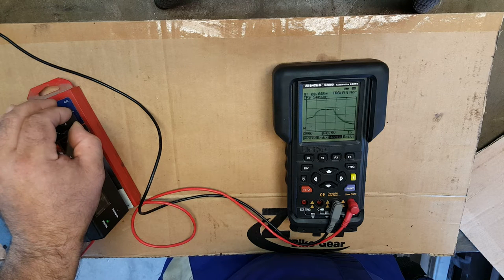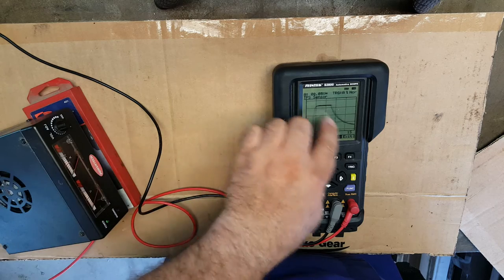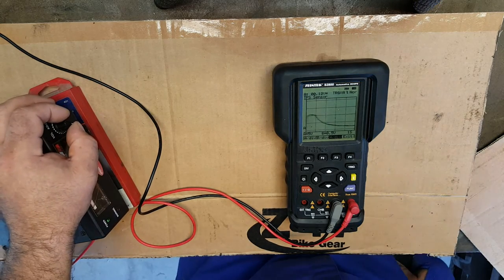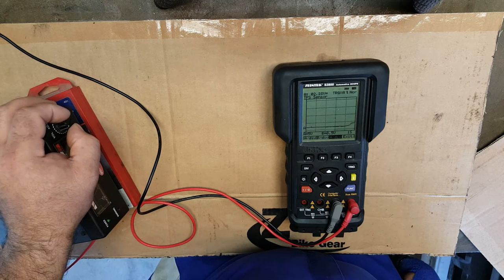And you know, we can create a sharp spike just by firing it straight up and straight back down again. You can see how the voltage tails off. So that would be the setting you could use for checking a TPS unit. And hey, we may do that later on in the video. I might take one off a car so we can actually check a real unit.